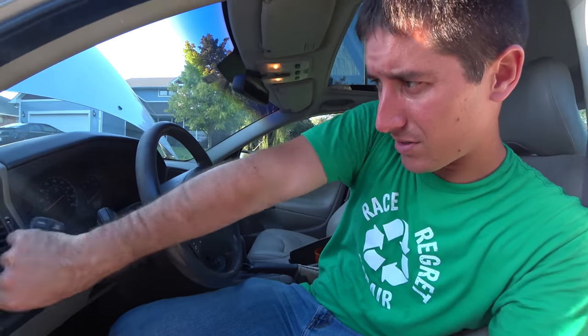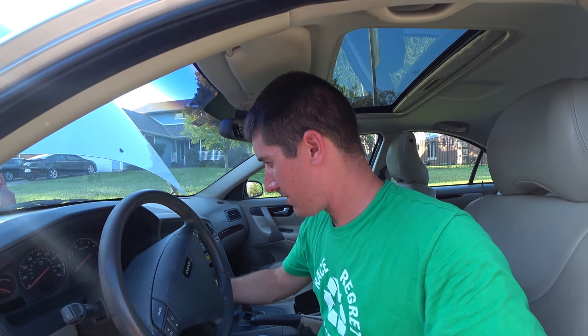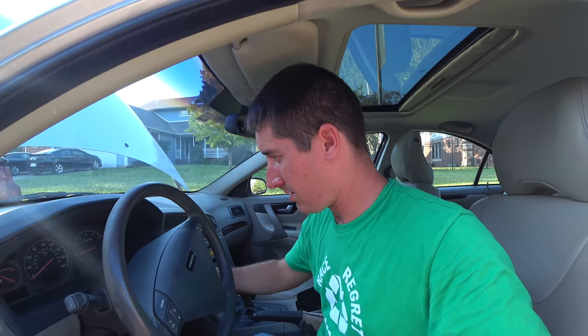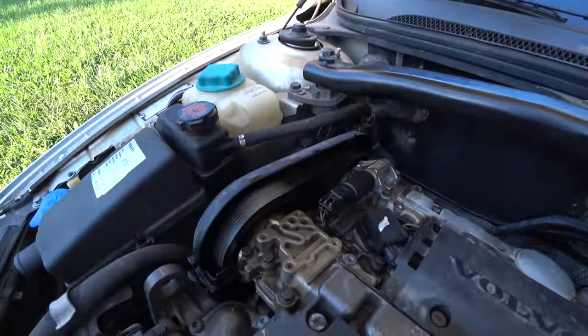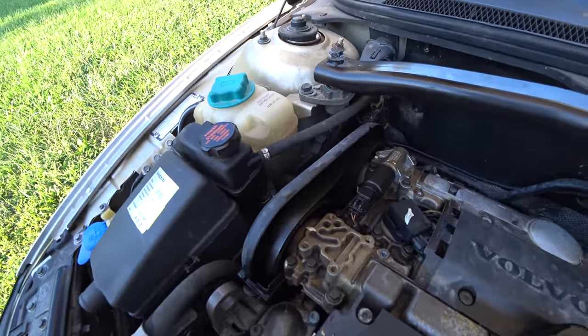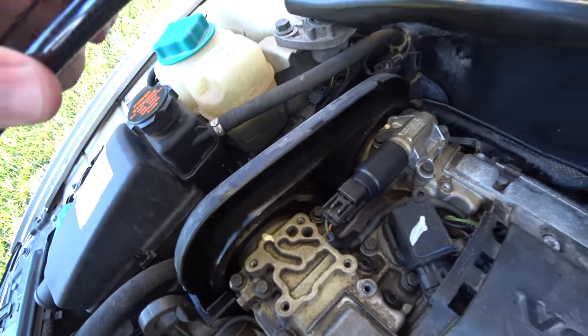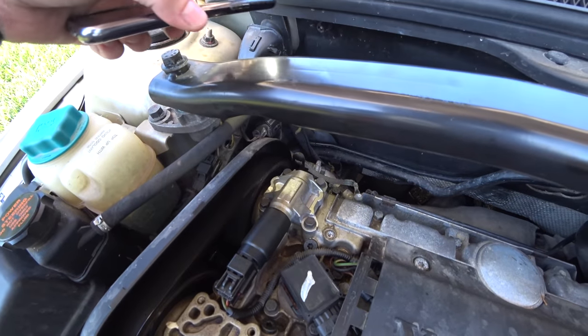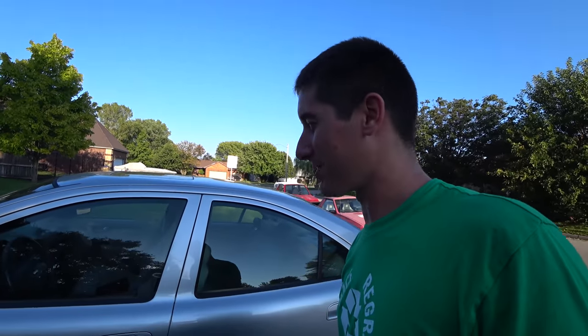Yesterday it started right up — and there it is. Let's see if we can see an oil leak. The belt is covered in oil — look at all the oil flying off the back of the belt right there. I do think it's coming out of that back cam gear. It's definitely a cam seal. After moving the car, I found out the AC works like an absolute champ — it started cooling so fast. I'm excited about the AC.